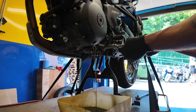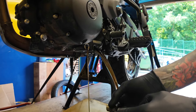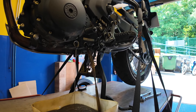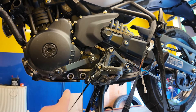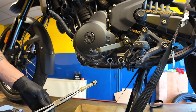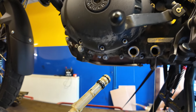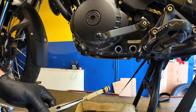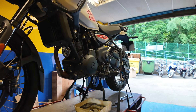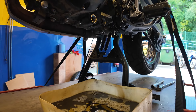What type of oil would they put in before it's changed? The stuff they now use compared to the early models — which used more of a run-in oil — is a lot better quality; it's not as black coming back out. We've got screens in both of them — just a case of washing them out and popping them back in again. You usually get a little bit on them on first service. It takes around two liters; you end up with about 50ml left over on average. The oil type is 10/40 semi-synthetic.